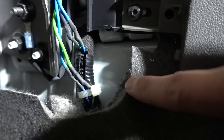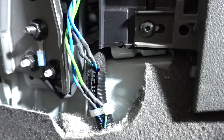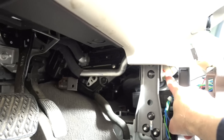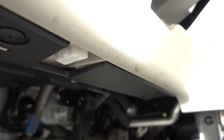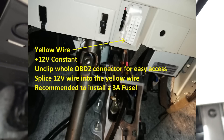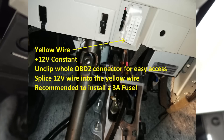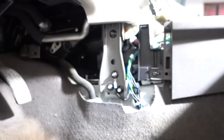It is also a good idea to cut out a bit of the carpet to gain more space for splicing the cabling. For the CAN bridge power, a red wire travels to the back of the OBD2 port where there is a yellow wire providing constant 12V — this supplies power to the CAN bridge. A small dedicated fuse is also installed, since the fuse covering the whole OBD2 port is a bit oversized. That wraps up the CAN bridge wiring.